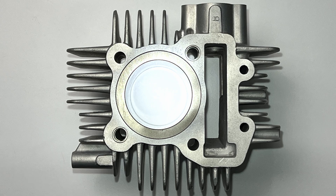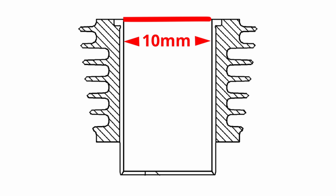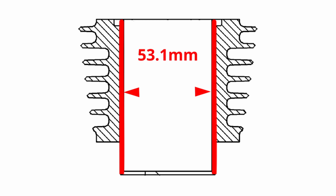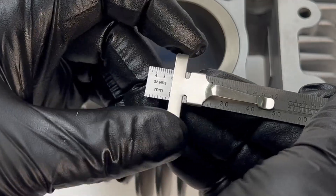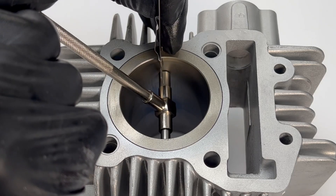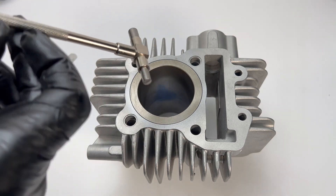Cylinders are measured in opposing directions at different heights to determine the cylinder's overall roundness along the entire bore. Checks are made fore and aft on the y-axis, and on the lateral side, which is called the x-axis. The first two depth measurements are indexed from the top of the cylinder, with the first taken at a depth of 10 millimeters, then the second at 60 millimeters, and the third measurement indexed from the bottom of the cylinder at 20 millimeters. The range of variability in a standard cylinder is between 52.997 and 53.009 millimeters, with the out-of-service limit at 53.1. Start by setting a depth of 10 millimeters on the scale gauge ruler, drop it into the bore, release the spring-loaded indexing rods, confirm the depth, tighten the set screw, then roll the tool out of the bore and confirm the inside diameter with the caliper.